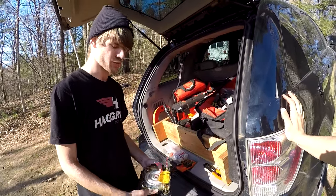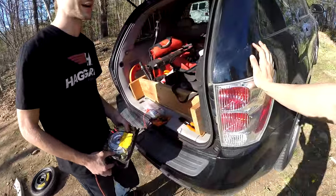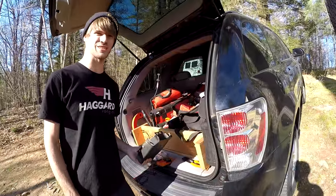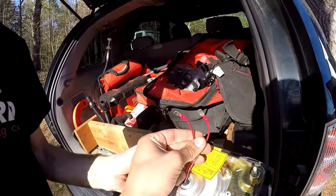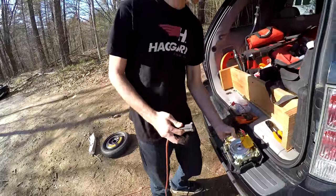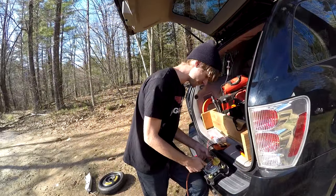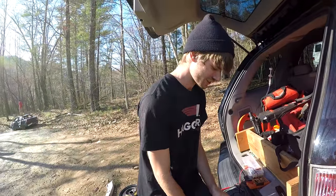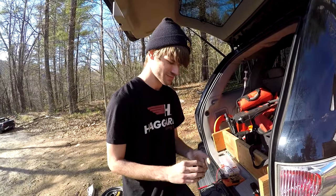We got this airbag and we want to send out the prism with a bang. We're hoping it doesn't catch on fire because we have very limited fire suppression out here. We didn't have any regular wire and I wasn't gonna touch this to a battery, so I put spade connectors on it. I'm gonna use a 120-volt wall extension cord, shove the spades into the female end, tape them up, and just touch it to the male prong from very far away. Hopefully it'll blow up — don't try this at home.